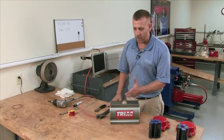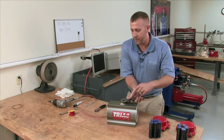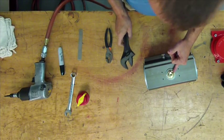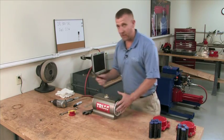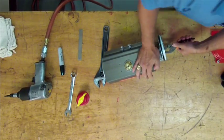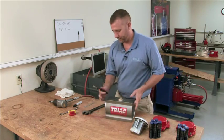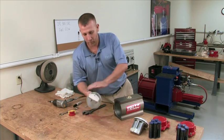From about a 45 degree angle, you want to continue to rotate this pinion 180 degrees roughly. Now your black mark is 180 degrees opposite from where it was. When you remove the pistons, sometimes they pop out, sometimes not — you can coerce them a little bit. Note the rack — the rack on that piston is your rack side. Same way on this side: piston, rack.